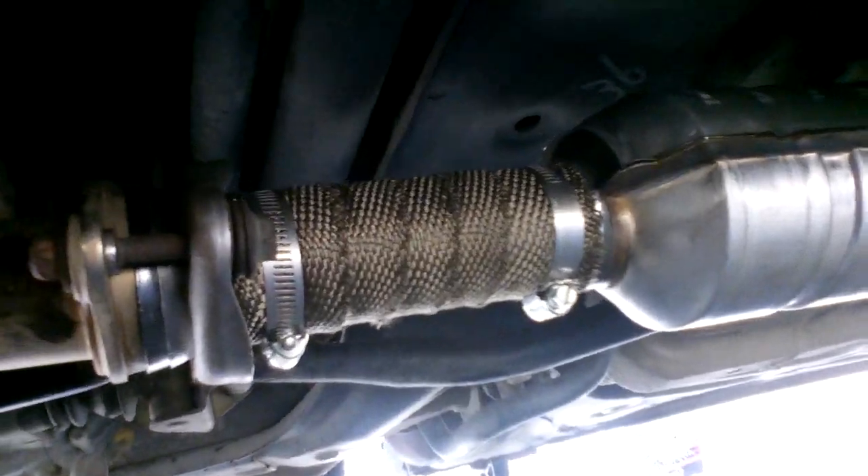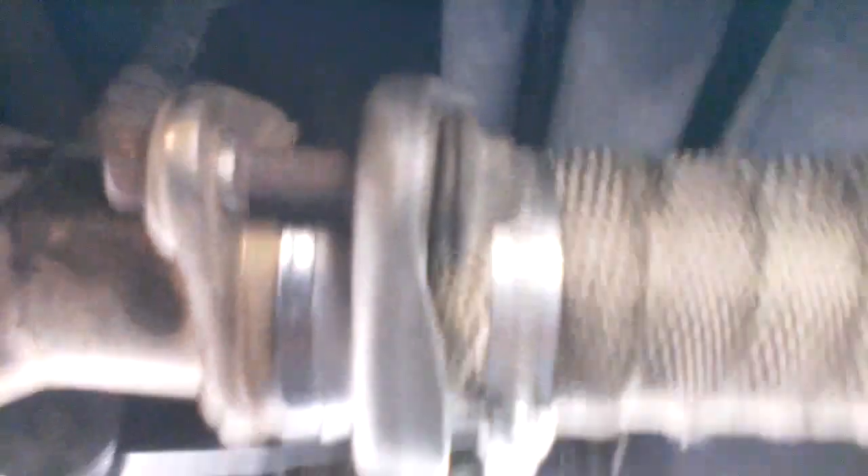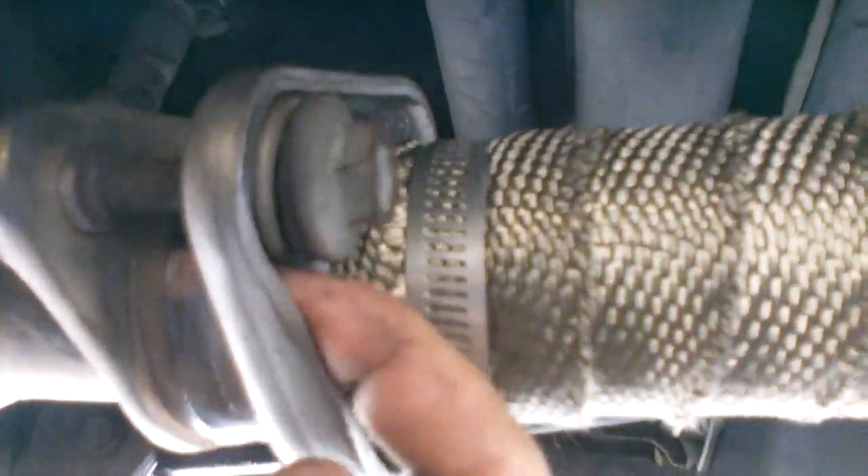She's in. See the modifications I had to make over here? I had to cut three and a half rings off of the spring so that there'd still be a gap and a little bit of spring tension. Because the flange on the stock unit — this face right here — comes out to about almost a good solid inch further back, which is another little problem. So this part had to pass through here, so you had to file that, and you had to cut three and a half rings off the spring. Make sure you put the flat part up against the bolt and the cut part on the flange — because there's a little cup in here so it's flat and then it ramps up, so it seats safely in there.